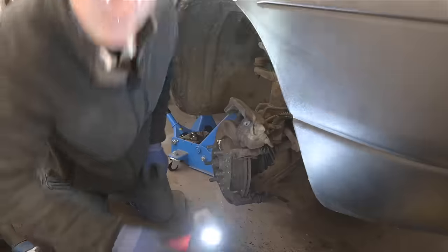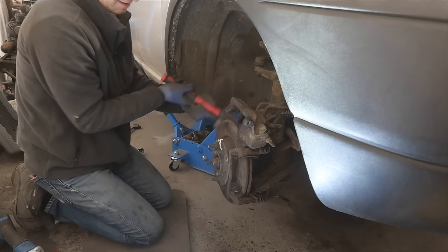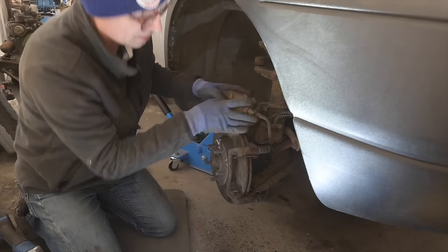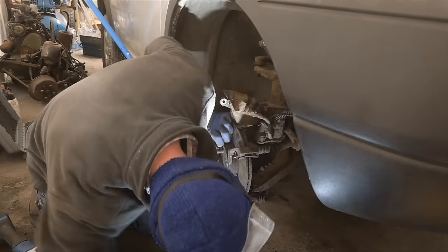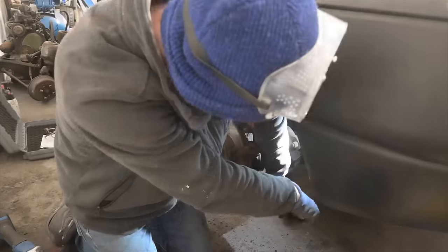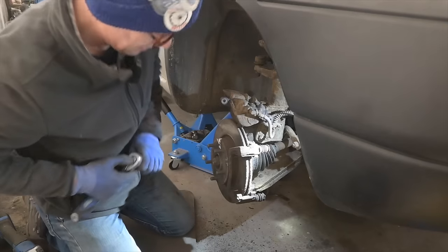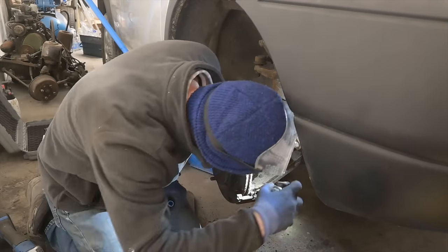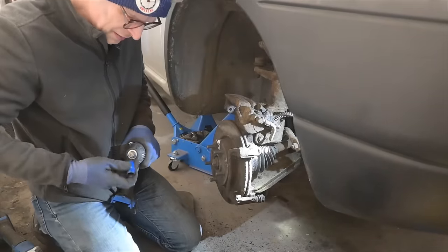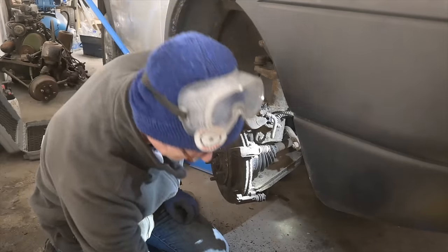Right, is that free-ish? Handy thing to put a torch on is that big hammer. Yes it is — I just need to release the two big bolts in the back of it which I'd kind of forgotten about. The caliper carrier bolts — I guess those are going to be 15mm probably? Right, will this come undone? Oh my gosh, no it will not. Where is the impact wrench? Bit more Bulldog. You know you get to a point in the job where you just lose any sympathy for any of the components. The bottom one just flew straight out on the impact wrench. Now let's try the impact on the top one.